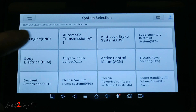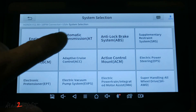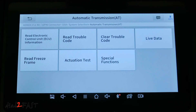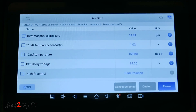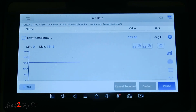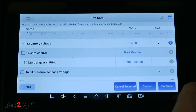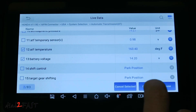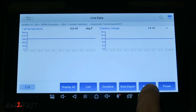Next, let me show you system selection. Here are all the different modules you can select, check for trouble codes, and do your troubleshooting. Let's go into automatic transmission and look at live data. For example, right here is ATF temperature, which shows the temperature of your transmission fluid — right now it's 161 degrees Fahrenheit. If you select the down arrow button, it'll show you a graph of the temperature reading. You can pause this reading, or select multiple PIDs — for example ATF temperature and also battery voltage — and if you hit continue and select custom, then select graph, this will show you the graph of both PIDs. You can also choose to record this live data and export this data.